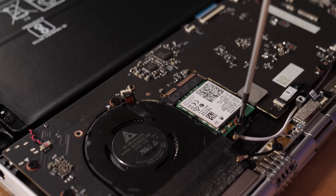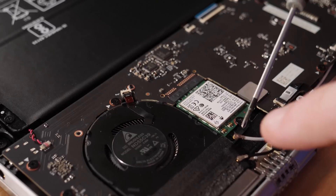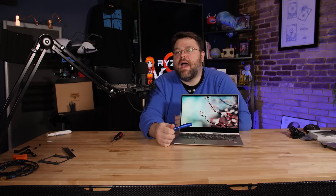It's a lot better than the 10 to 100 megabit I was experiencing before, so this is a lot more satisfactory. If you want to do this upgrade yourself, all you need is a T6 Torx screwdriver, and a 00 Phillips screwdriver to take out the Phillips screw that secures the wireless card. The antennas just snap in — just be real careful when you're removing them. You can do this upgrade in 20 to 30 minutes max. If you get lost, come to the forums at Level 1. I'm Wendell, signing out, and I'll see you there.